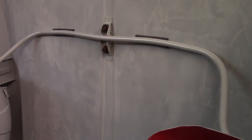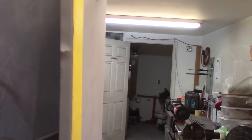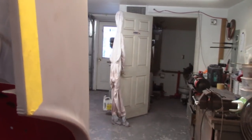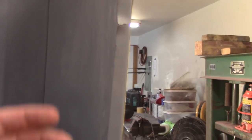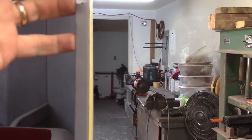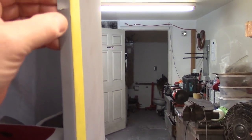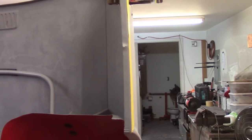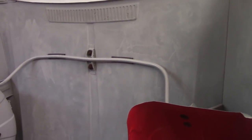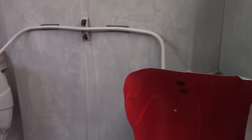The goal is to get the side-to-side portion of the bonnet adjusted properly. I've got this tear on the trailing edge that I'm going to try to hammer flat a little bit, and a little deformation on the other side. One of the guys on the Triumph experience forum mentioned putting a reinforcement plate in on the horizontal portion — maybe drill a couple of holes and do a quick plug weld — since I'm going to weld anyway. It may be worth just an extra layer of metal there. Anyway, I'm going to get it all unbolted, get it all cleaned up, get the nuts and bolts nice and pretty, and get some adjustments done.